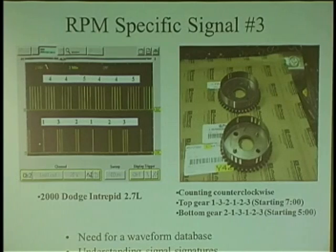Boom, it starts up. I'm like this. How does that work? And it sets a crankshaft sensor code. I said to the guy, dude, something's going on with the crank sensor. No, I'll bet you didn't plug it in right because it has that stupid green connector lock. You can never get it back in place.